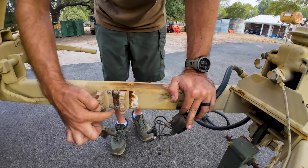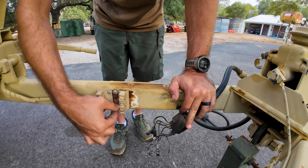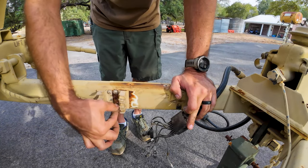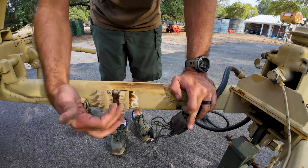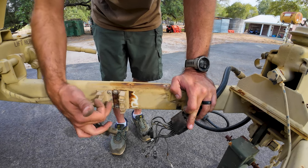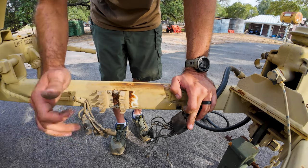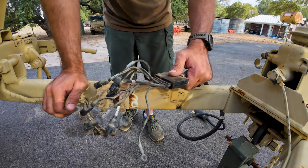I put the screw back in and tucked the ones to the side over here. Reuse that same exact one as the ground because it probably already had a good ground. You'll see what they usually do is they grinded away the CARC paint so that way there was a good ground here. So now that this is totally free, we want to go over to the bench.